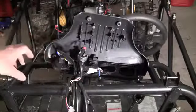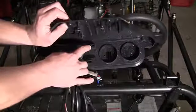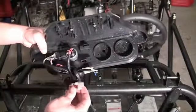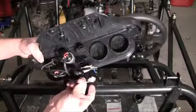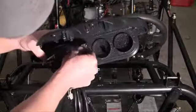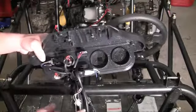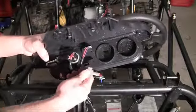The only other things we have to install are the horn and the turn signals. The horn uses this red and purple wire — well, candy cane and purple. Now these aren't the industry standards for these wires; whenever you get your wiring kit, look at the diagram to see what your colors are.